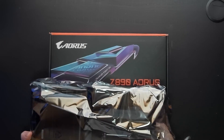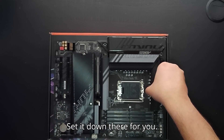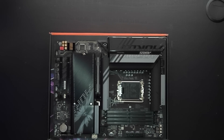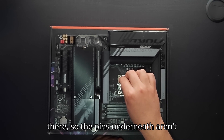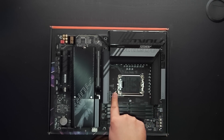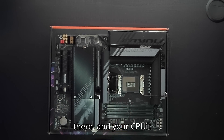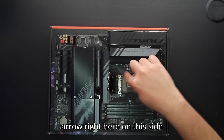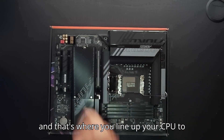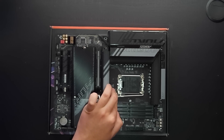Let's pull the motherboard out and set it down. Your CPU goes right here — it's good to see that cover still there so the pins underneath aren't damaged. This is the retention bracket; you open it up, pull it up, and your CPU sits there. On the motherboard itself there's an arrow right here on this side, and that's where you line up your CPU to know what orientation it needs to go in. Then you simply put the bracket back down.